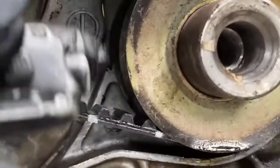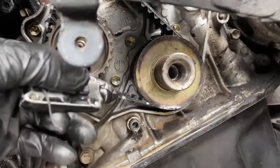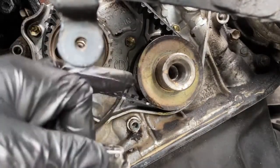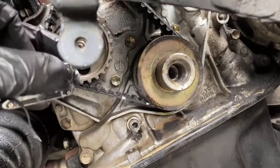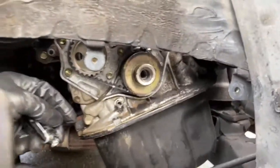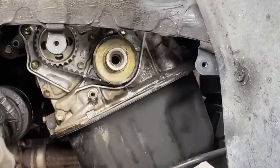And we might have a positive crankcase ventilation system buildup. We'll have to replace the PCV valve, because we might just have some positive crankcase pressure going on here, enough to push this oil out. Because again, I don't think that's a high pressure oil area, but I don't know, because I think the oil pump high pressure section is over here, pickup tube is down there, etc. So we'll have to pull that off and see if those are cracks, which they kind of look like.